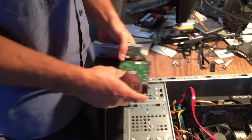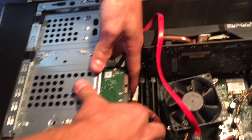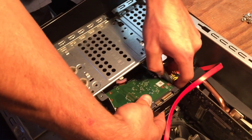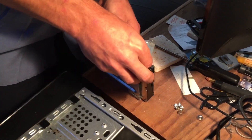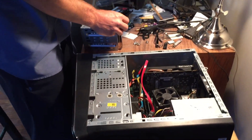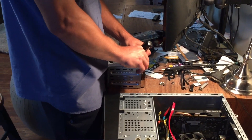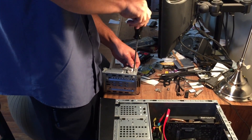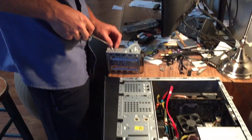Make sure of the orientation before you put it in there, get it all screwed down. Put four screws in there so it's solid while it's spinning. Walker has taught me the difference between magnetic hard drives and solid state hard drives — huge difference. This magnetic drive he's putting in has increased capacity but it's old technology with moving parts, and it's much easier to damage.